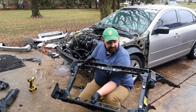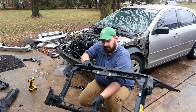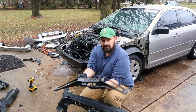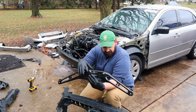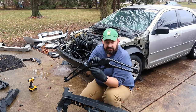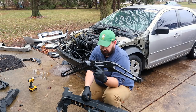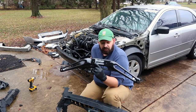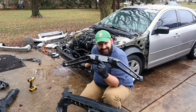I've been pulling things off the old one and attaching them to the new one and I'm just about ready to attach this to the car. I also pulled out this piece that I had to order. Ford just calls it a support, but it's basically a cross piece that attaches to the core support that the hood latch assembly bolts onto, as well as the front crash sensor. This actually gets sandwiched in between the core support and the bumper crash bar mounting brackets, so I need to put this on at the same time. Now I'm ready to start putting all these parts in the car.